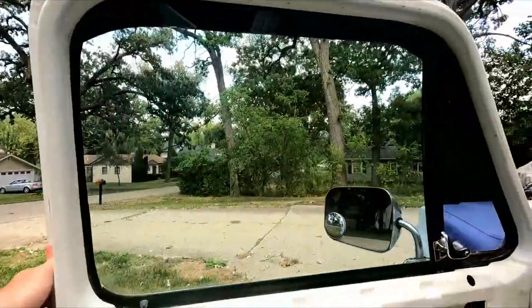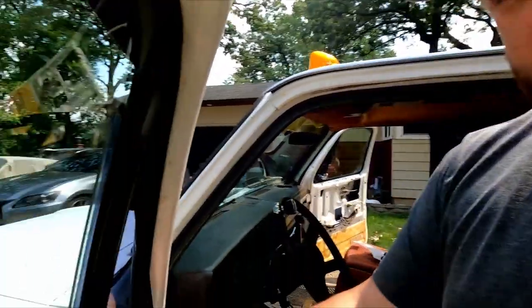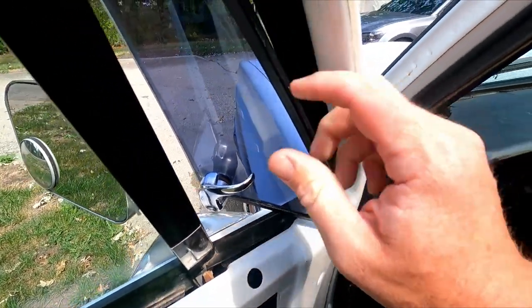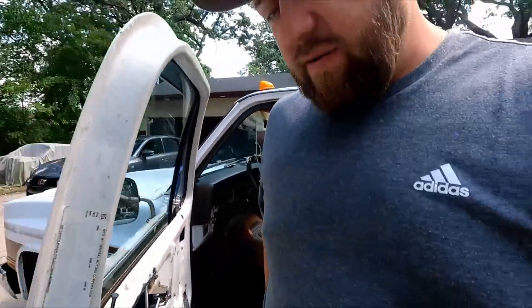Let's look at the driver side to see how it functions. You can see it's locked, and it flies up nice. You can open it up — it's a bit stiff. There's a spring underneath with a nut and you can adjust the tension, but it's not crazy stiff. I do want to do new seals on here eventually, but for right now I'm gonna replace this hardware, or at least attempt to. I've never done it, don't have any instructions — just gonna give it a go.